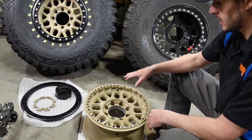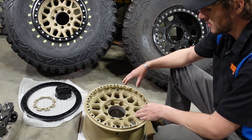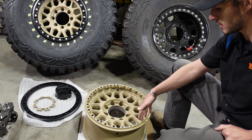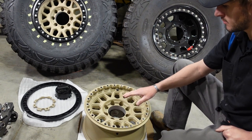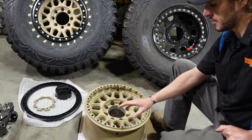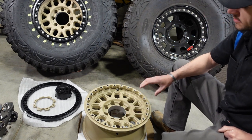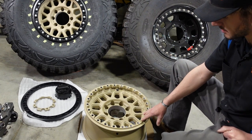Now, moving past that — the inserts had red Loctite. If I had to take these to 400 degrees for powder coating, I risk destroying the powder coating that I just spent more money on than I spent for the wheels almost. So definitely don't want to use red Loctite. I'm using blue — medium strength thread locker — so I can get it out without all the heat and without destroying my powder coating.